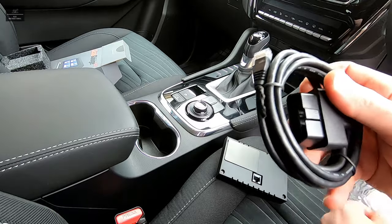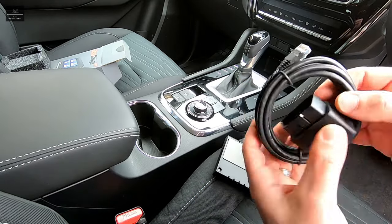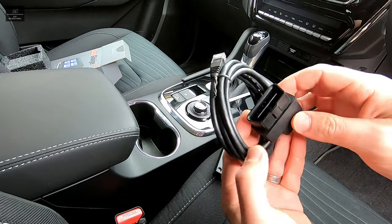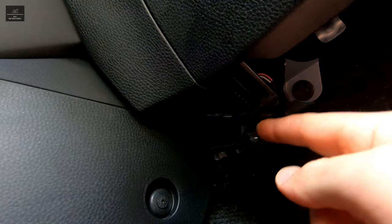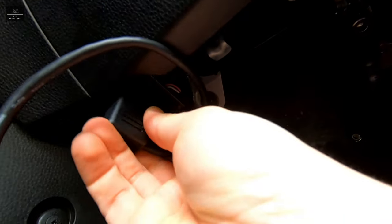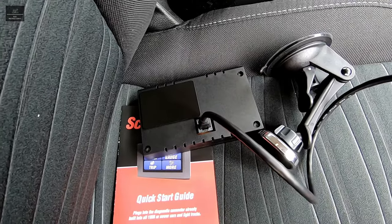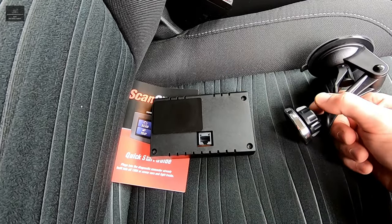While that's bonding, I'm going to grab our OBD cable. It looks almost like an Ethernet cable — this side connects directly into the back of the ScanGauge, and this is the OBD2 connection point. It's a matter of locating it for your particular vehicle — usually it's on the driver's side, probably in the footwell somewhere. The OBD port on this particular vehicle is just in the footwell on the driver's side. We get our ScanGauge cable, plug it in place there, push firmly in, and that side is now connected. The other side simply plugs into the back of the ScanGauge. Now that our steel plate has finished bonding, I've just removed the cable to make it a little bit easier for first-time installation.